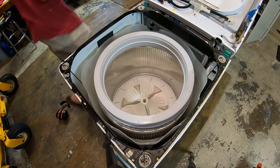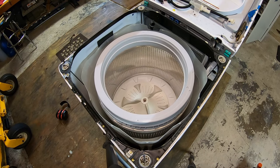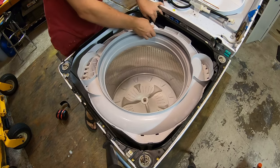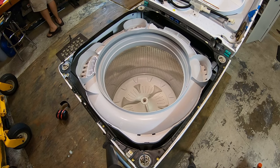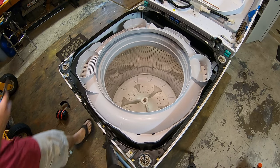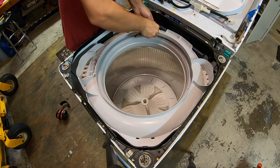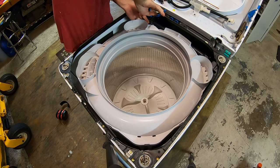Okay, agitator's on. Now we gotta put that top ring on. It only goes on one way, because that hose connection's in the back. Put this on like so. Put our hose connection on first. We gotta get that clamp on. Our pliers, put that right here. Hose clamp pliers. There we go. That should do it.